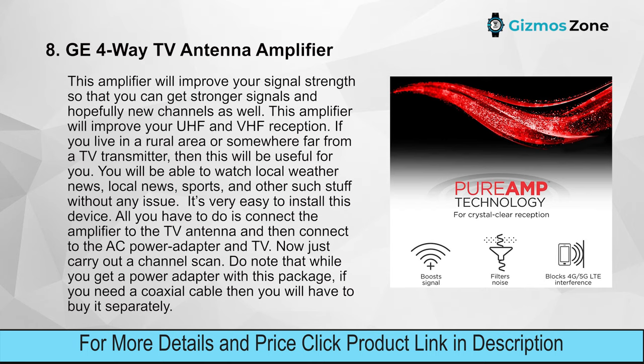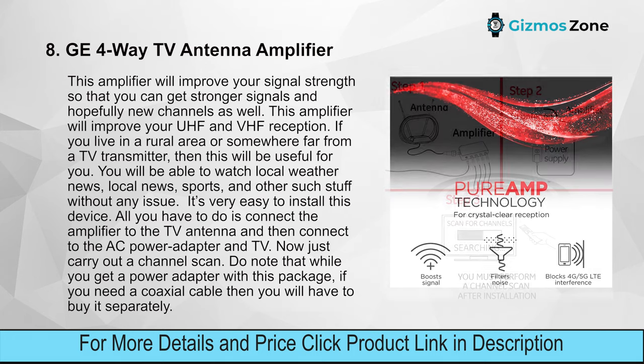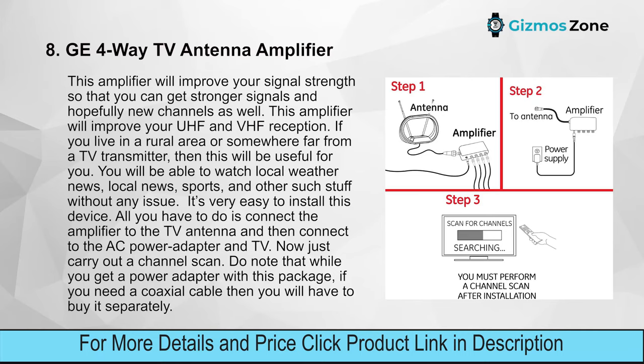It's very easy to install this device. All you have to do is connect the amplifier to the TV antenna and then connect to the AC power adapter and TV. Now just carry out a channel scan. Do note that while you get a power adapter with this package, if you need a coaxial cable then you will have to buy it separately.